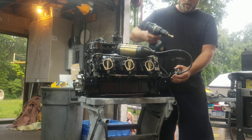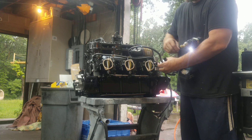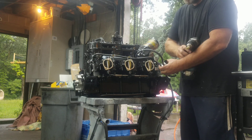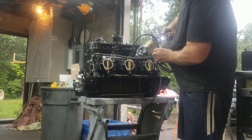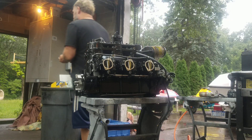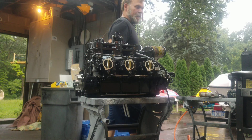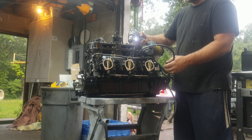Then I'm going to crank this drill motor over backwards, and then I'll check and see if I'm getting oil coming in — which would be a lot easier with two people, but unfortunately there is only one of me. Wouldn't you know it, that fitting is not going to fit. You're going to have to use the bolt. The other one works a little better on the 787 because it helps keep it from popping off, so that's why I was hoping it would work, but apparently not.